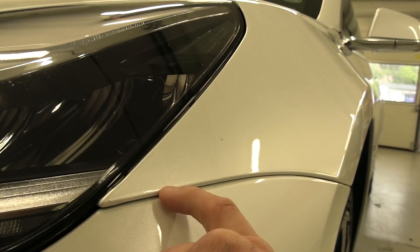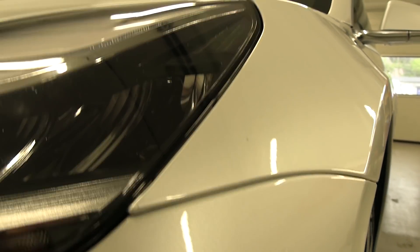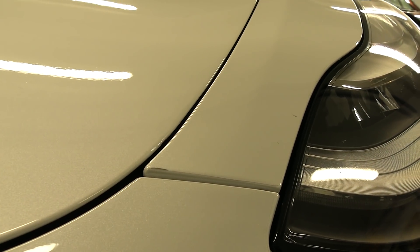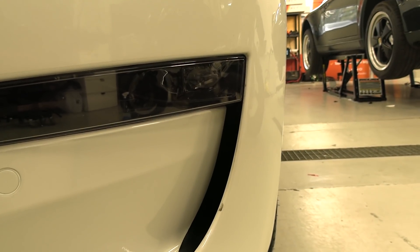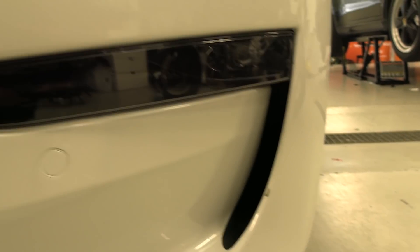If you put the material all the way inside, you can have what's called the puckering effect — the two parts push the film together and you get huge wrinkles. We have the same issue over here too, a bit more ugly but it's more like dirt with something underneath, so eventually we'll need to trim this also. We also found something on the front bumper — he had something unplugged before, which may be why it's lifting. We'll fix that and trim a bit. Parking sensors are all good.